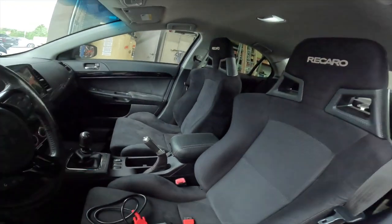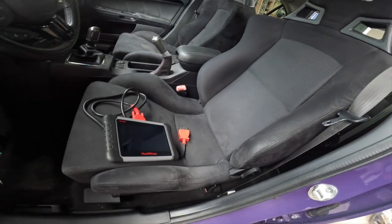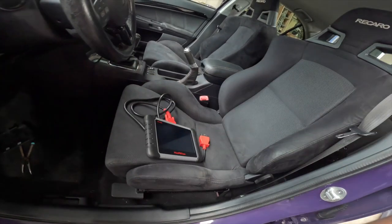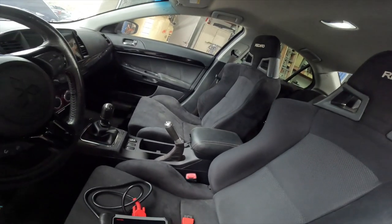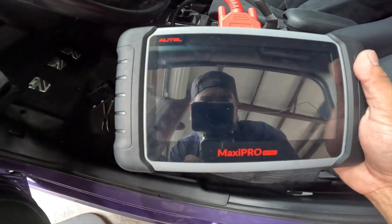Seats are in, steering wheel's in, all the plastics. Now it's passenger side — here we go, and we are all done. A couple of key items you will need: Recaro seats, more complete the better. They have to have pretty much everything — the SRS all hooked up, the occupancy sensor. Find a minty set of Recaros. They probably won't come with the amplifier because they like to sell that separate, but as long as it comes with all the airbag components.